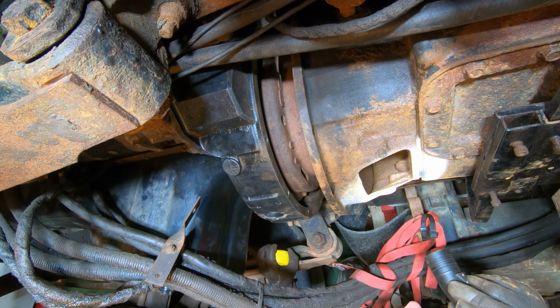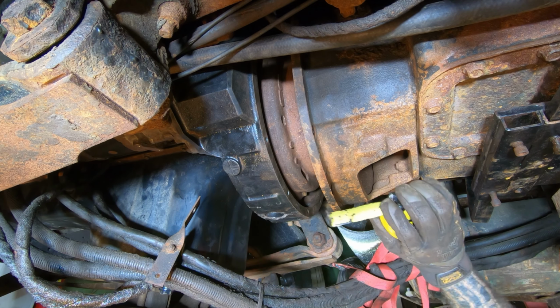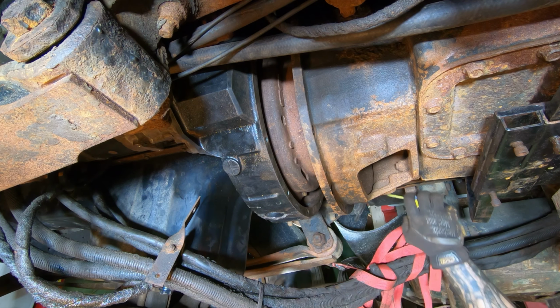I agree. You should be good. So a way to see if you're centered or going in straight is you just kind of measure here the flange. So I'm 2 3/4. Over here I'm 3. Here I am just a little under 3. I'm on 2 3/4 though, so what I need to do is probably make it all 3. Because I'm pretty much 3 side to side, so I gotta tip this forward a little bit more. I'm gonna get closer to 3.